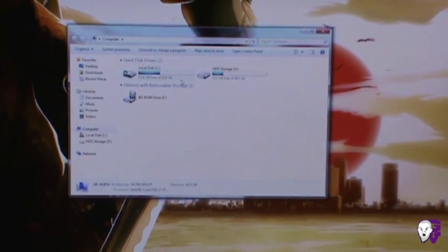Let me go over my hard drive setup. I put the Vertex 4 SSD in here, and I still have the standard 500GB 7200RPM drive that came from Alienware. I set the Vertex 4 as my main boot drive and OS drive. For the secondary drive, I went ahead and reformatted it — I wouldn't do this unless you want to reinstall everything from scratch, but this is how I did it to keep things clean and simple.